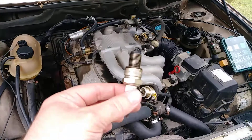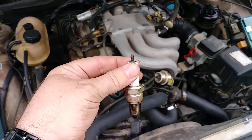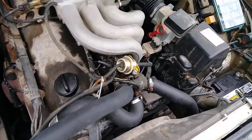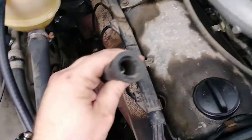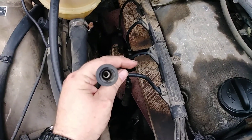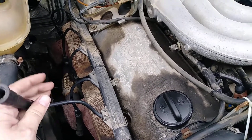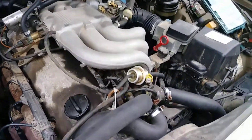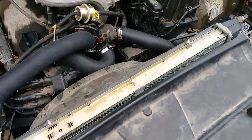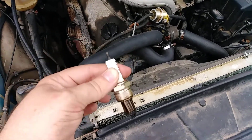The bad news is this spark plug is what we need. We do need one with the screw type top, because these plug wires in there are very, very tiny and will not fit a standard spark plug. It's got to be those little ones. So I went to the auto parts store O'Reilly's — they didn't have any, which is odd, because this is where this one came from originally. So probably going to have to order them online.